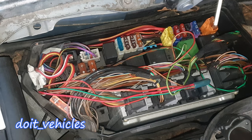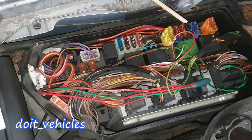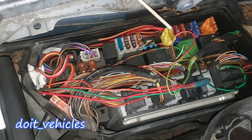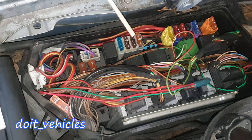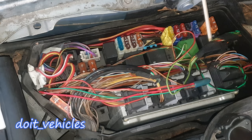The 60A fuse is for the electric suction type fan. This one is for the heating system recirculation unit. This one is for the steering wheel heater and DC-to-DC converter control unit. This one is for the blower motor, blower regulator, and heating system recirculation unit. This one is for the headlamp range adjustment control module. This one is for transmission electronics including the engine oil fan unit, transmission oil fan motor relay, auxiliary air unit relay, and heater booster. This one is for the active body control module.